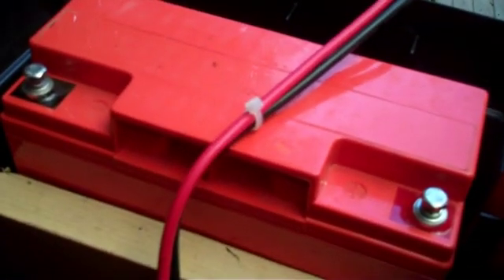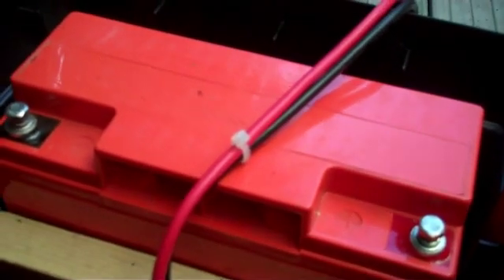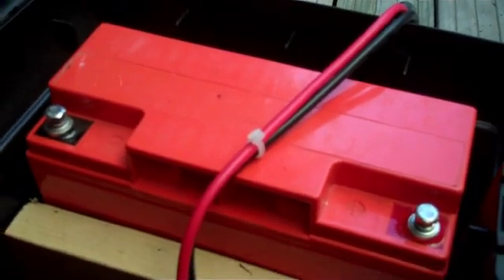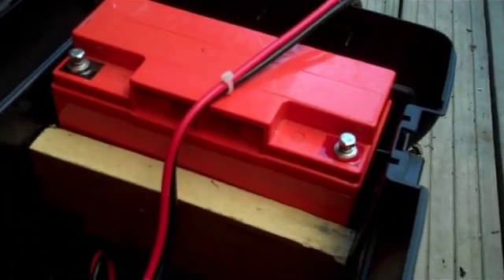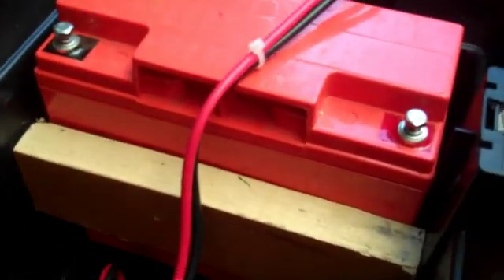The battery is a sealed battery so the ventilation is purely for getting rid of heat — this won't leak any hydrogen. If you're using a leisure battery or traction battery, you need to be aware that hydrogen gas will build up as the battery charges, so you will need to ventilate for that.